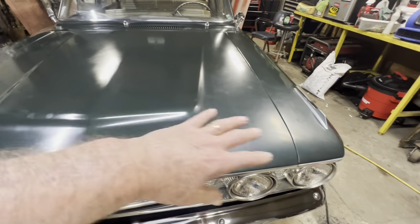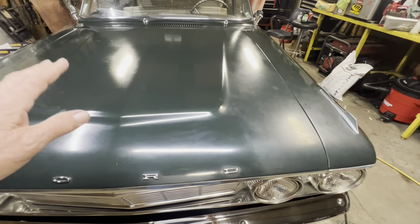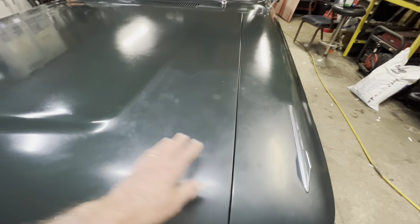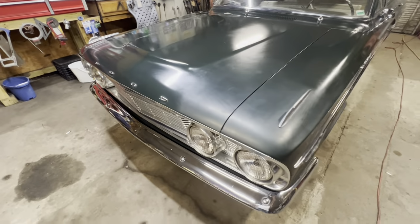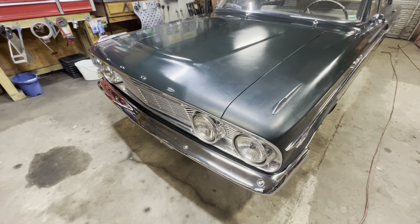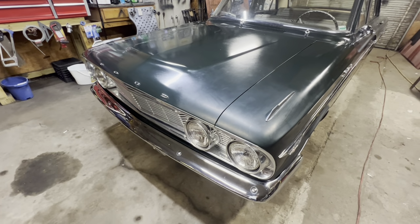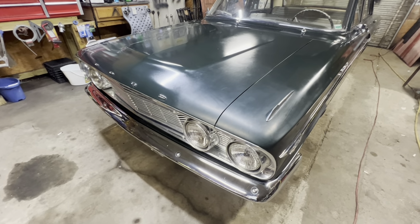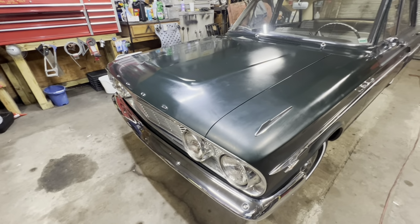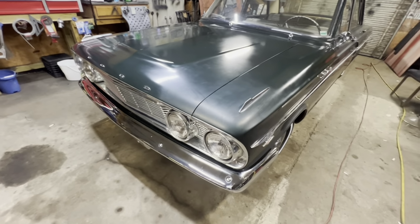See the difference in that and that? I washed the whole car with Joy dishwashing liquid. I was trying to get the oxidation off, and it was making my pad sticky. My pad was just getting covered with that stuff. So after I waxed it, I went back over it again with Joy dishwashing liquid, and it took it off pretty much, so I could buff it.